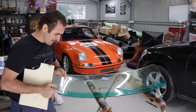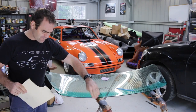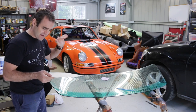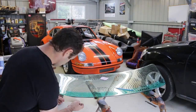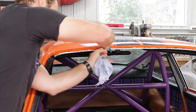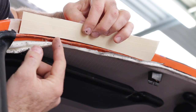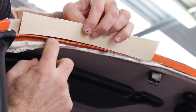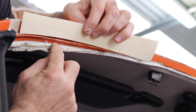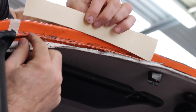Here's my new windscreen and my idea to try to get that lip back into the right shape — I'm going to make a template off of the curve of this edge of the windscreen that I can then take back and forth over to my lip and panel beat it back to the right shape. You can see the gap here, how low this area is sitting where the windscreen is supposed to go. I need to beat that back up into shape because it sitting down so far meant that the rubber was stretching to try to get over that lip and it kept flicking back.